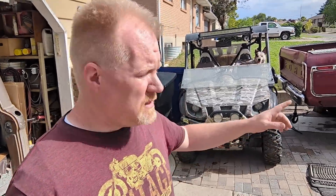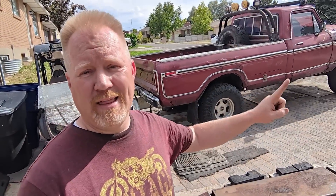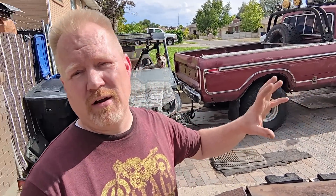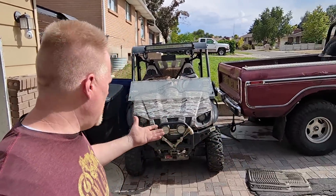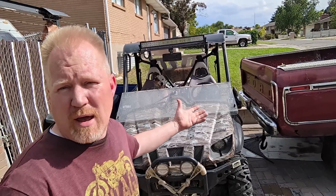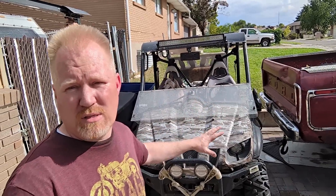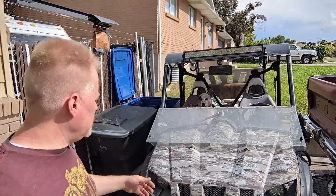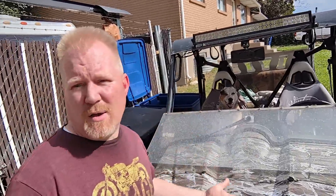What we're going to do is actually take the charging system from something like this — a Ford 1G first generation alternator — and we're going to adapt it to fit in here. Looks like we have room. Nobody's ever done this before. I'm going to do it, bring you guys along, see if we can do it. Three times the power output, should never have problems in the future. And if the alternator goes bad in the future, it's easy to replace. The stock alternator is completely built into it.